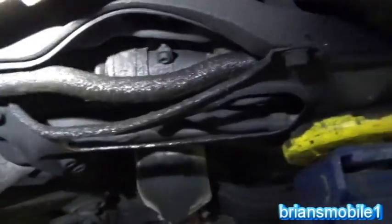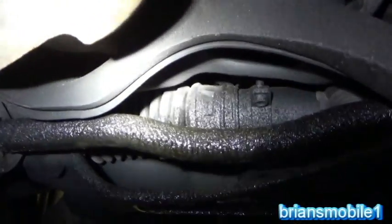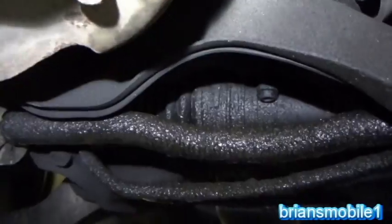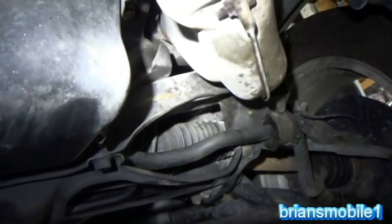It just keeps coming back and then there'll be a trail of oil. The problem is if you leave this unattended and don't fix it, basically the oil gets all over the rubber boot for your rack and pinion, it makes the rack go bad. One causes the other to fail if you just ignore it. You can see the boot or the bellows on this side of the rack — it's totally fine.